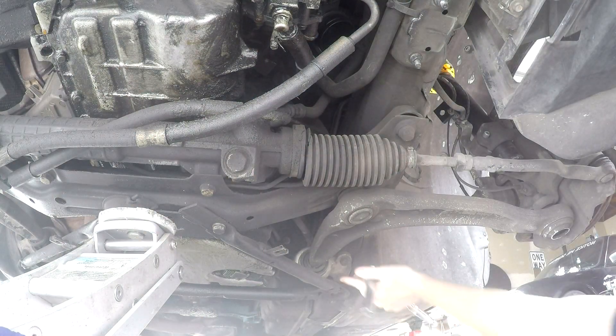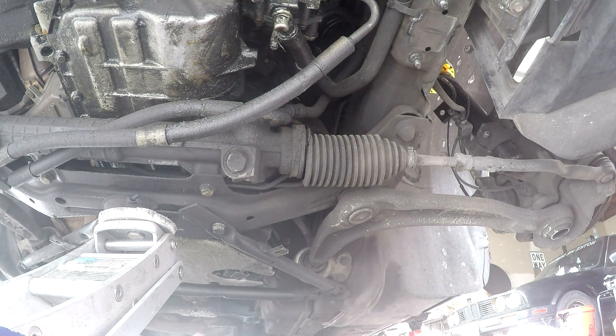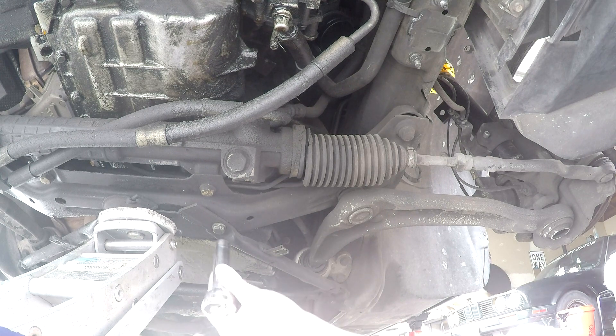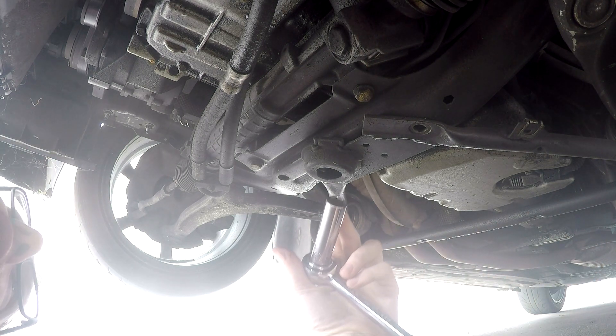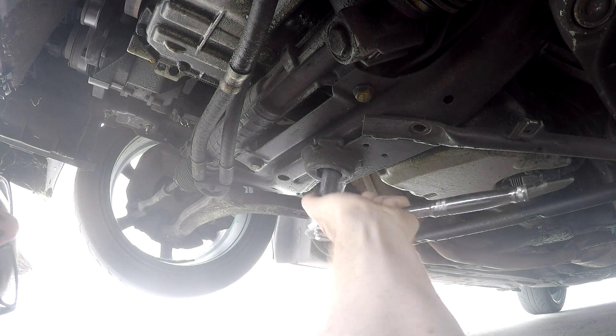All right, so the wheel is off with a little bit more access to what we're looking for here. Don't mind all the oil leaks — I have a leaky power steering hose that's just destroying everything down here. But the first thing we do is, if you look at the front control arm bushing, the whole little carrier assembly, we see that there's this front subframe brace in the way, so we need to remove this. There are a series of 16 millimeter bolts — one, two, three, and four — so we're going to take off this brace so we have full access to the carrier. The last bolt holding the whole thing goes actually inside this little void where the front jack point is on the front crossmember right here.